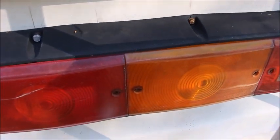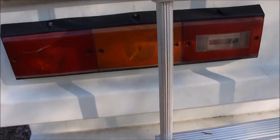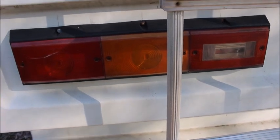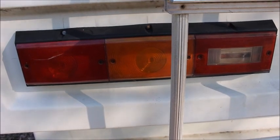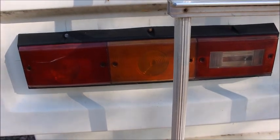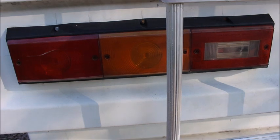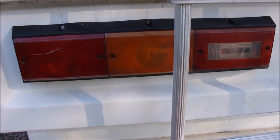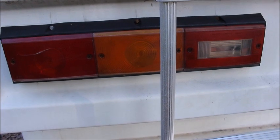I have looked online and have not found this light online anywhere. This light is 21 inches long; the longest new light I can get is 18 inches and it costs through the nose. So what we're going to do is take this light off because it's not really in that bad a shape - the gasket's just gone. I'm going to try a trick I saw someone post on a video about taking a yoga mat and cutting a gasket out to go around this RV tail light, the turn signals and brake light assembly. We're going to give that a shot and see if it works.